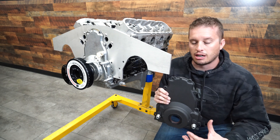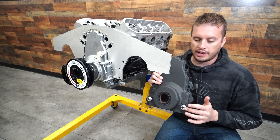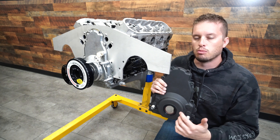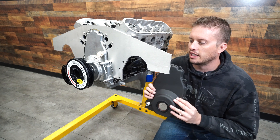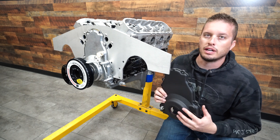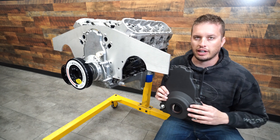If you're running a Corvette-style balancer, they're very tight to the cover, so there's not enough room for this fitting to clear and to put an AN fitting on top of it, let alone get it on and tighten it. Same with an F-body or GTO-style balancer with AC on the back of it. It's not a one-size-fits-all, but for a lot of folks if you're running an ATI or aftermarket balancer without AC, it's a very easy and good fix. Truck balancers will fit as well.